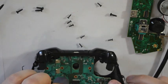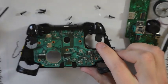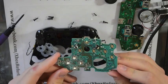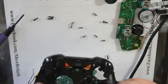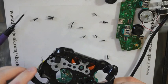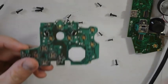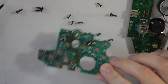The screws are kind of a pain, but they make for a very solid feel of the controller. Once you get this part out, you pull this board — pull it up in the back, ease it out a little bit, then pull the whole board back and it'll snap out of there. Here we have the interior PCB board. Set the other piece off to the side.